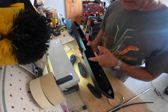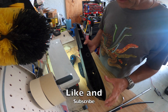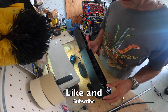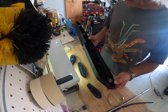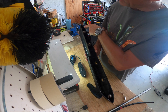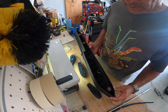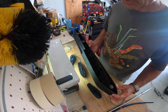We have to make room for the transducer inside here. With all these stringers, when we cut them out they'll probably reduce the strength of the stabilizer slightly, but once it's in there it's going to protect the transducer more at high speeds when we're out on the water. I'm planning on having the wire running up on the upper side, basically all the way down to the end, and then straight up to the receiver so we can see the clear view, sonar, and everything else up there. Stay tuned.